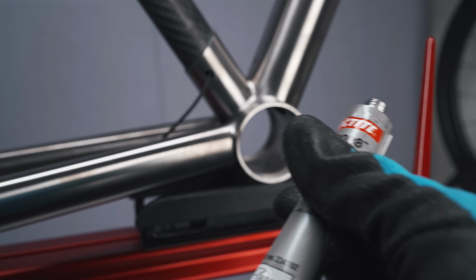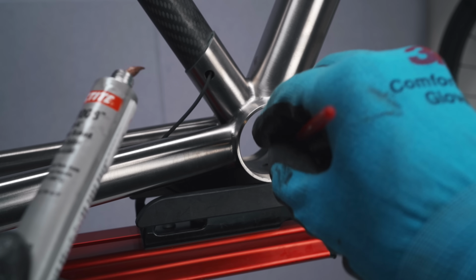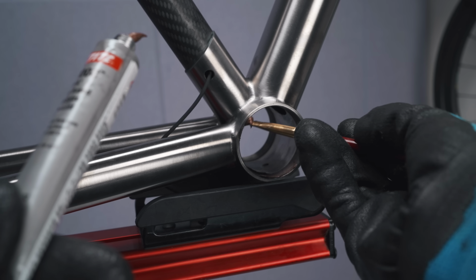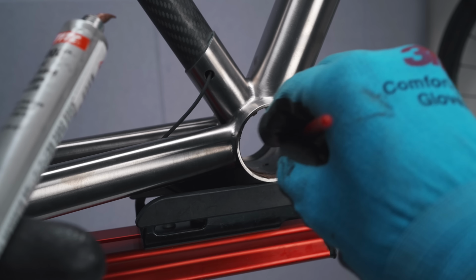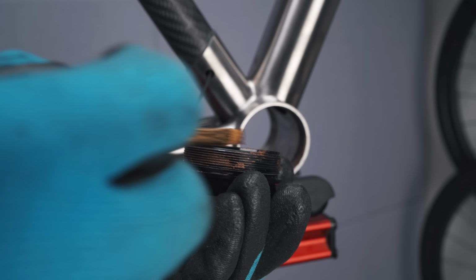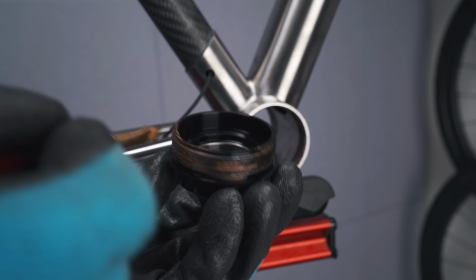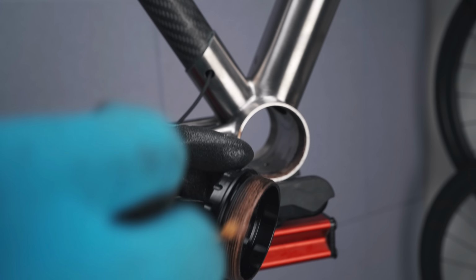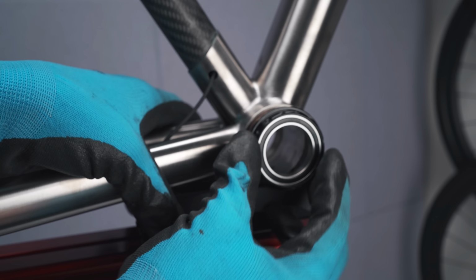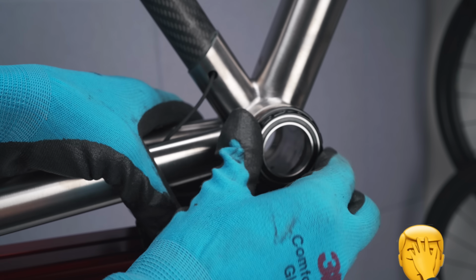Since this is a titanium frame, unlike other frame materials, anti-seize or copper paste will take the place of normal grease on all interfaces where titanium meets aluminium. Or aluminum. Whatever. I'm not native. Those materials can marry for life if you let them. And not having any copper paste is like having a divorce without the prenup. Shit can get nasty. I'm sorry, that was weak.